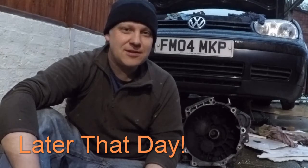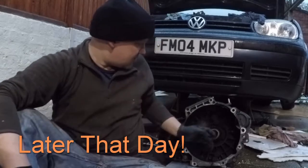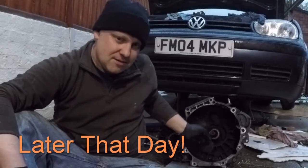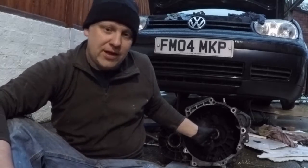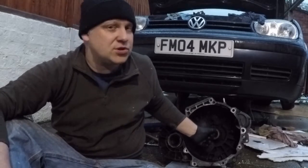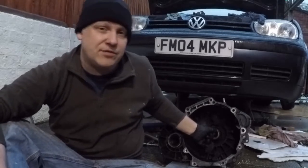The weather's changed slightly and the kids got up a little bit earlier than I expected, so we had to go and play. The gearbox has come out though. I think I've sourced the noise, so I'm going to take the clutch off and have a little look. Play on the input shaft may be enough to cause a slight difference in the application of the pressure plate - I've known it to happen before.